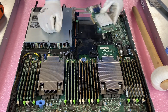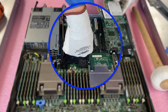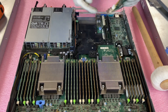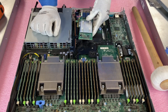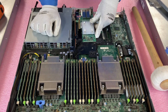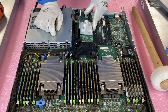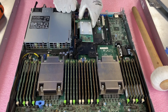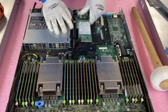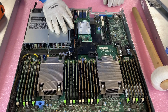I will note this one is a little bit difficult in the sense that you have to line up like three things at one time. This black piece — the PCB — will actually go into there, and you need to line up the two leads at the same time, plus line up the back, and this piece needs to go in down here. So you need to line up a lot, but once you get it all in it's nice and easy, though it can be a little difficult making sure everything is 100% flush. There we go — got it in, everything's looking good. It got a little stuck so we shimmied it, and the bracket was getting stuck in the back, so we pushed it down a little bit more and there we go. You've got the PCIe version of your NIC card installed.